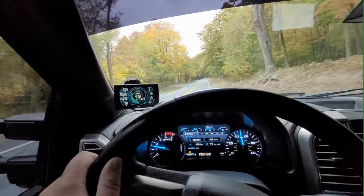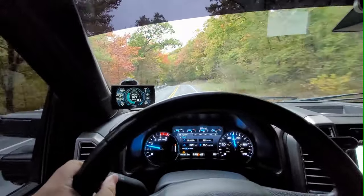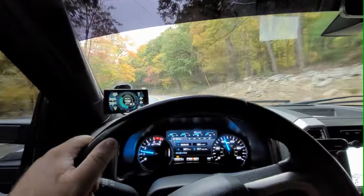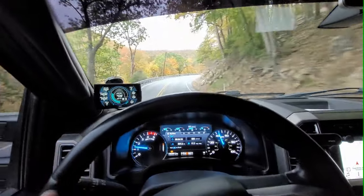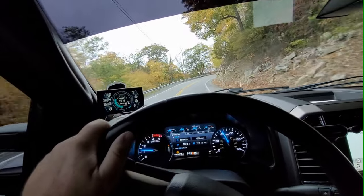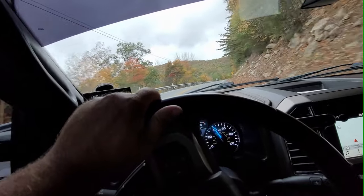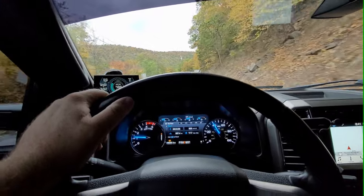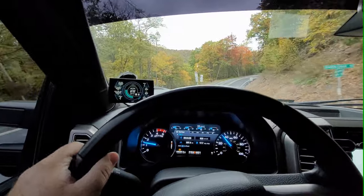Exhaust temps, I mean, are lucky to hit 1,000 degrees, so that's a huge thing right there. All my coolant temps, oil temps run way cooler than before. Also, everybody's asking me about fuel mileage. I would say at this point I got about 1,000 miles on the setup, and I'm running probably about 2 miles a gallon better if I had to guess. Just seems to really do better on fuel, so time will tell on that as we get some more miles on it here.